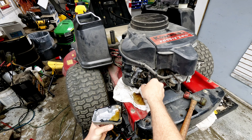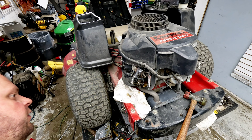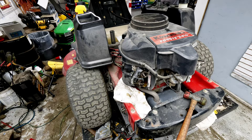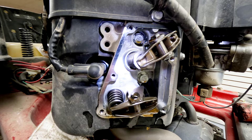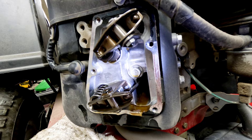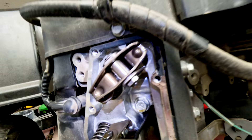The gasket came off in bad shape — that's okay, a lot of times they're just brittle when they come off, no big deal. Let's see what we've got. Everything looks in pretty good shape and pretty tight. Not really seeing any issues with the valves or anything else at this point. We did hear that backfire, so we know something's going on over on this side.